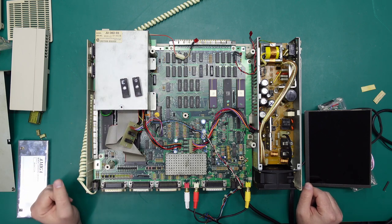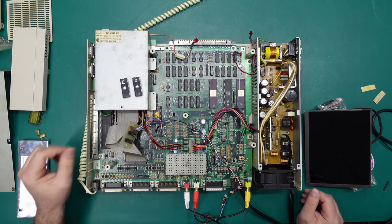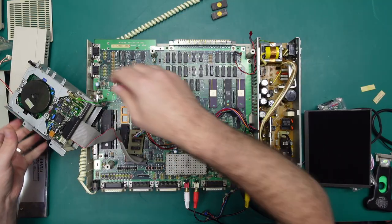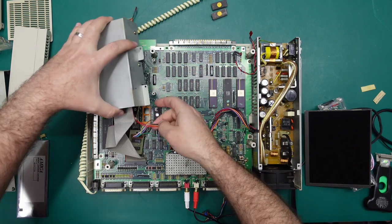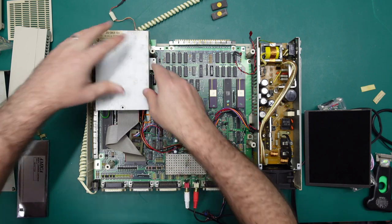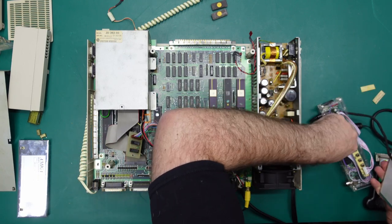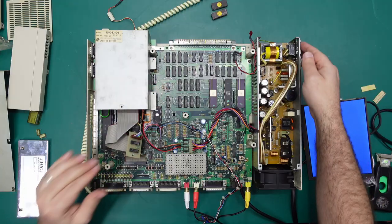After a quick look online I found the original kickboot ROMs, or bootstrap ROMs, or boot ROMs - whatever you want to call them - and I've burnt them to some EEPROMs, so let's stick these in and see if it makes any difference. The pins look like they're all in, haven't bent under anywhere. I don't know if these jumpers are set correctly because I think that is also part of the modification when you try to put the whole kickstart image into ROM. That's reassembled - I'm just going to sit that up there so it doesn't short to anything.